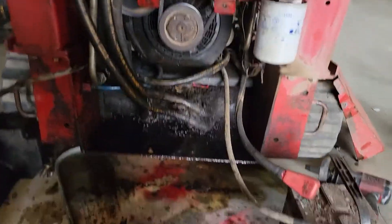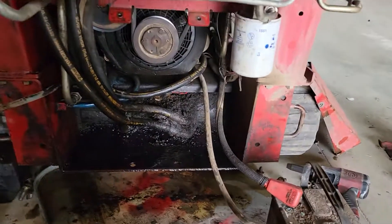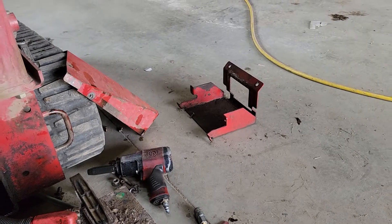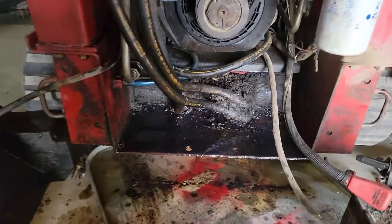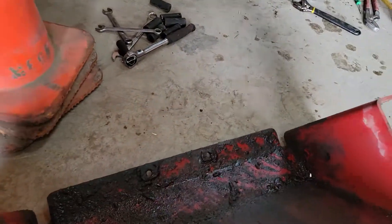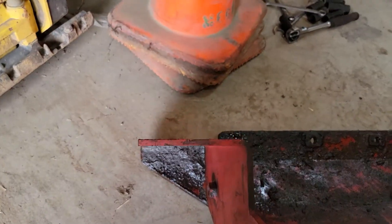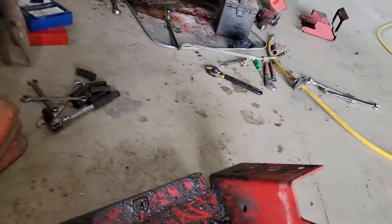What you have to start with is pretty much the battery strap — take that off, take the battery out, get the cables out of the way. Then you have the battery mount that needs to come out. All the bolts and everything are pretty easy to find. Then you got to take the back plate off — there are just two bolts at the bottom underneath there and four bolts on the sides, two on each side. They're three-quarter inch, probably 19 millimeter — no real difference.